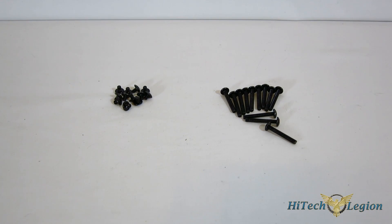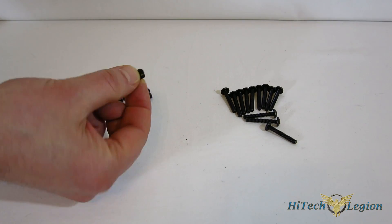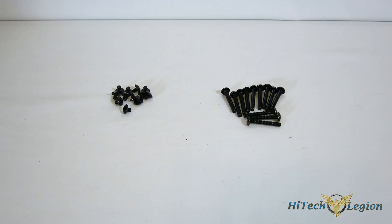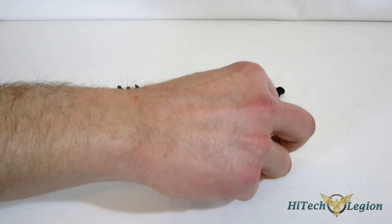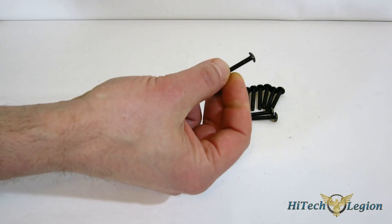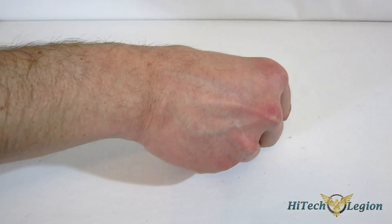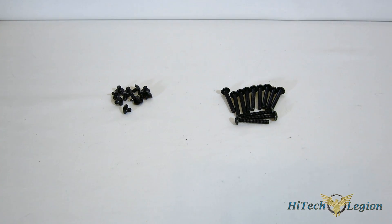In terms of accessories, you've got 12 short screws for mounting to the case and 12 fan screws. I did earlier say that screws were included for push-pull — I was wrong about that. It is only 12 M4 screws included, all black as you see here. So if you're going to be doing push-pull, you will have to buy some additional screws. Now we're going to get this into a simple loop, put it in the case, and see exactly how it cools.